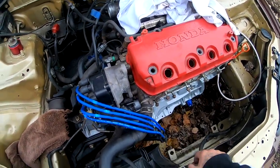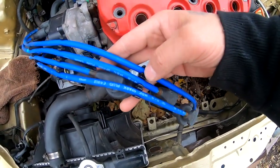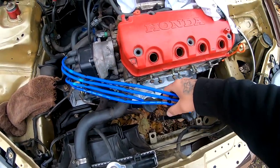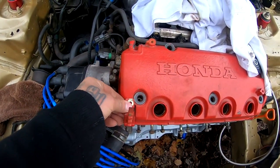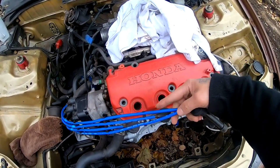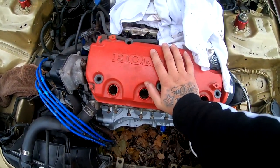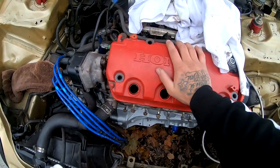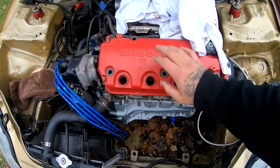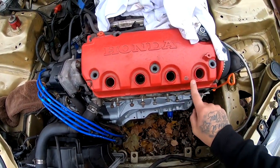I went ahead and put these new clips on here — these hold the wires together so they'll be nice and uniform when they go down the strip right here. I went ahead and removed the old one, we're not going to need it anymore. I don't have the wires in right now because the valve cover is just on here to cover the head from any dust particles. I still got to put the gasket that's going to go underneath this before I put it on. Also, these plugs have to come out because we're going to need colder plugs.